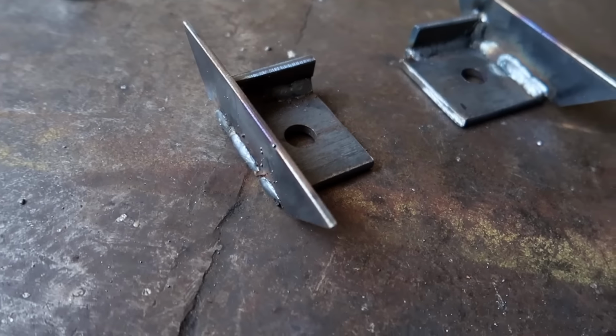And now we are ready to skin the outboard sections of the floor using the same 15/32 inch plywood that I used for the center portion. To get a stronger joint between the center and outboard sections, I used a router to create a 2-inch wide lap joint in the plywood, before attaching it with wood glue and countersunk deck screws.